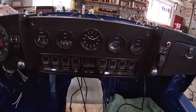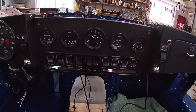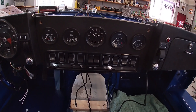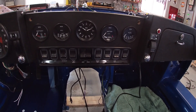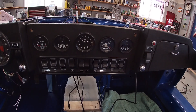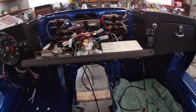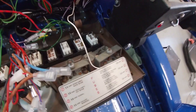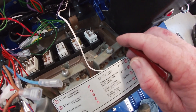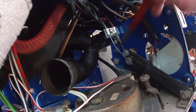The center instrument panel I renovated a while ago and it's been set ready to go. I've double-checked the orientation of the gauges and I've got that right. I need to double-check the switches on the inside, which I'm going to do in a few minutes. Theoretically this is easy to install — there's a shoulder bolt which acts as a hinge, which comes in from each side.